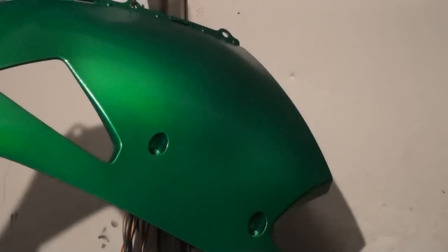It doesn't matter on the candy base if you get a little bit of orange peel, because when it comes to clear coating it, you would put a thick uniform layer of clear coat anyways. For an optimal shine, all you gotta do is sand down or cut the clear coat with like 2000 grit, or you can start off with 1000 then go up to 1500 and then 2000. These plastics — they are the belly pans of my fairing — they go through a lot of abuse. Since I use my bike for touring, it is going to get torn up, but I'm going to try to take care of this paint as much as possible. If you're doing this on a hot day you're going to want to break this down with some acetone — it's okay to mix acetone in this, or lacquer thinner. Lacquer thinner through DupliColor is a medium dry time, so it's going to take a lot more time to flash off before you can throw another coat.